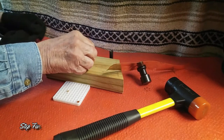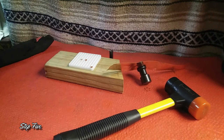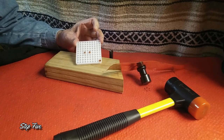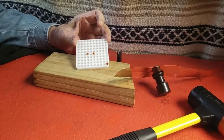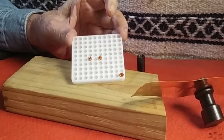As with the can technique, reposition the strip for each successive cap. Avoid cutting into a previously cut hole. Now comes adding a shock-absorbing material inside the shell. The shell is, after all, just that. An aluminum shell, and just a shell alone, is not going to protect the cone.